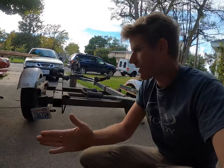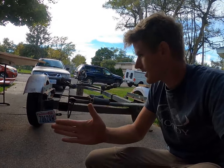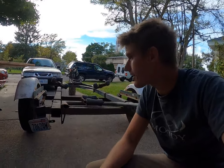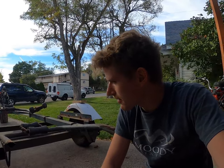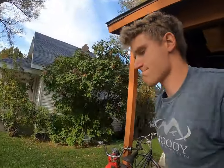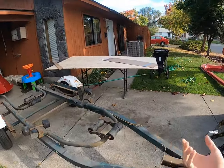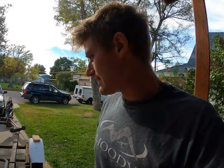I have to adjust the trailer a little bit to get the boat to fit on it properly, because the end of the boat comes about here. If I want to put bunks on it, I don't want to have the two by fours sticking out two and a half feet and not really being supported by anything. So I'm trying to figure out how I can make this trailer longer. I might put a tongue extension on the front, make the tongue about two feet longer, and then I can move everything up two feet so the whole entire boat will slide forward. I want to get the trailer done before or shortly after the bottom of the hull is finished.